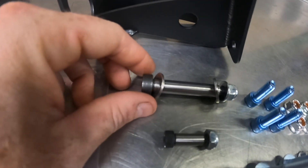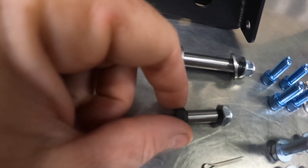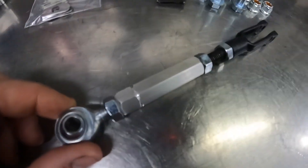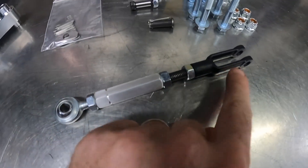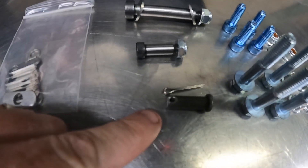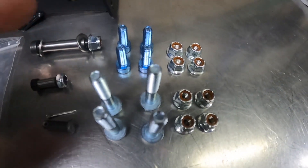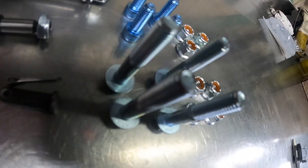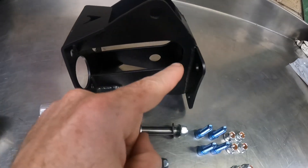There's a large pivot bolt for the top of the rocker arm and a small pivot bolt for the rod end at the bottom that goes through the slugs. This arm connects the bottom of the rocker arm to your factory pedal, with a pin that goes at the factory pedal location. The hardware also includes socket cap bolts for the master cylinders to the bracket, and depending on your application you'll have longer or shorter bolts that hold the bracket to the firewall.